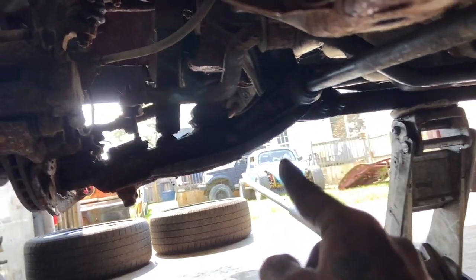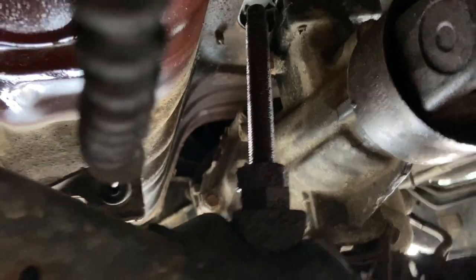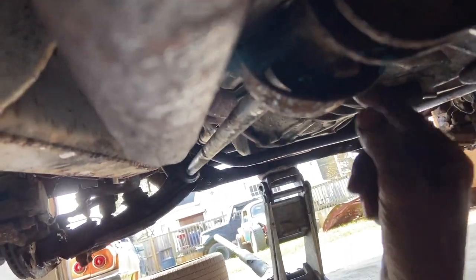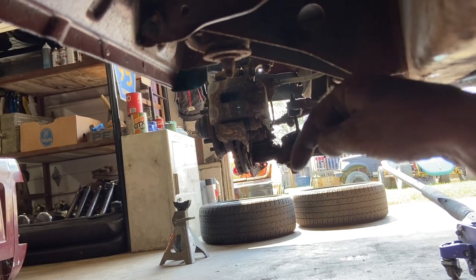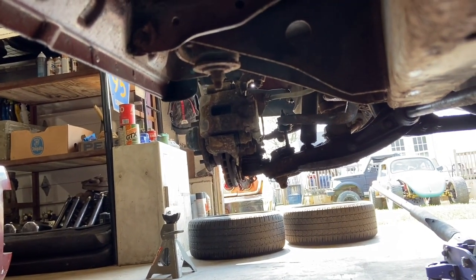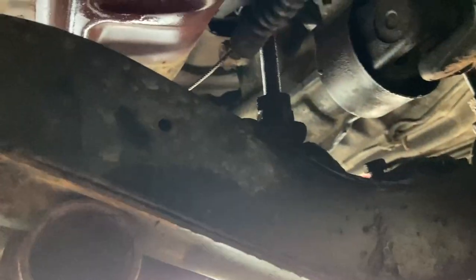This is the torsion bar here — it runs up to the lower control arm, and in the back it just mounts to this crossmember. It has this bolt here — it's just a real long bolt that goes up to the top. You can see a couple of nuts and that big long stud there. All it does — you turn it one way, it actually twists this bar and puts torsion on it, which will raise the front. You go the other way, it releases torsion or twist, and it'll drop the front. I've been spraying these down with oil all week, so hopefully they spin loose pretty easy.